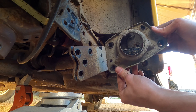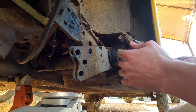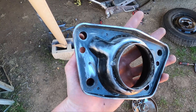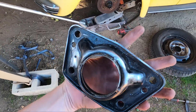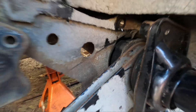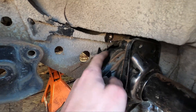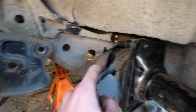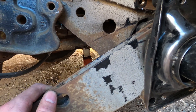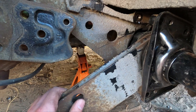Since I actually got this off, I'm going to take a wire wheel to it and get all this caked-up mud off there and then pop it back on. Sometimes it's a little bit tricky to get it on here, so if you can get it off don't do anything until you get it back on. That definitely looks a lot better. It took a little bit of finagling but I got it down one spline. You can see the bushing up here is a little bit misaligned so I'm going to need to rotate it in order for it to fit in that notch — but just by looking at that you can see there's a slight angle change, and that's all we need to get about two inches of ride height change on this car.